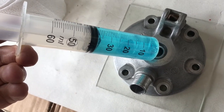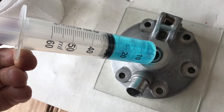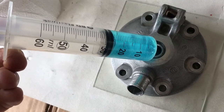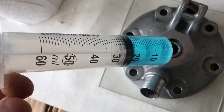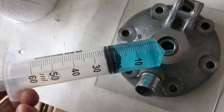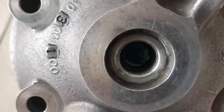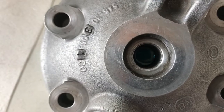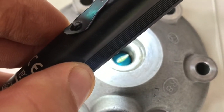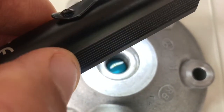So I know it's going to be definitely over 20, so I can go down to my 30 mark. Now I'm going to start being a bit more careful. You can see that the liquid has just come to the threads. I've got some light on there and you can see the surface tension going up to that first thread. So I now know that that combustion chamber is completely full.